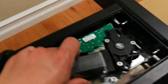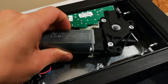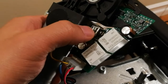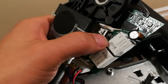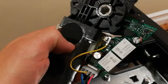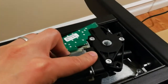I'll take it out and show you. It's very easy to take off the motor. If you can see — not the yellow wire, but below it — there's another electrical contact. It was very very loose. So I had to squeeze it, and now the desk works perfectly.